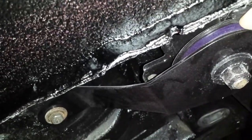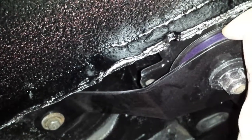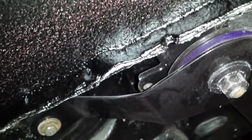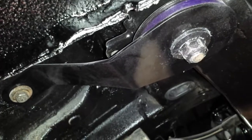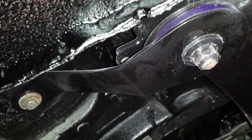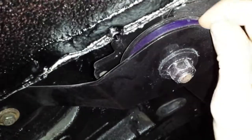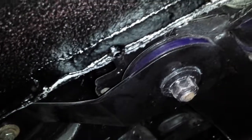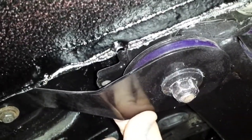This little lip, about 3/8 of urethane, is literally all that is keeping your subframe on the car when you jack it up off of the body points, or worse, as you go around a corner and you lean really hard. It's just that little lip keeping the damn thing on your car that is going to fail on somebody one of these days. So what you need is a flat bracket designed like this, nice and thick.